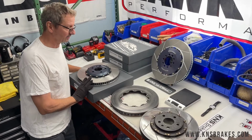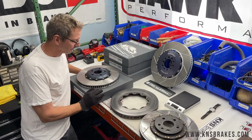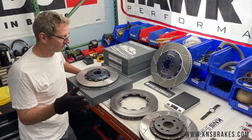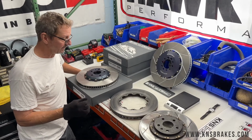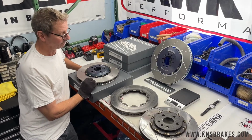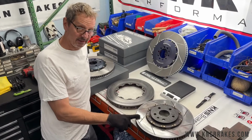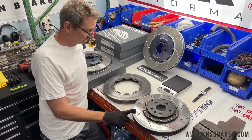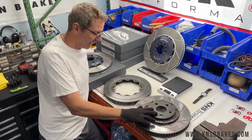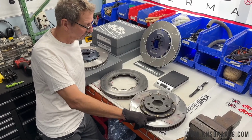And just as a comparison, we want to show you the other parts on the car and explain the differences real quick. Basically it's a 372 by 34 millimeter two-piece rotor assembly, both OEM and the Girodisc as well. The first differences are pretty obvious. You can see this is a Girodisc replacement rotor ring that we've had good experience with already, and that works with the OEM GM Brembo hat. And you see their hardware design. We've been selling these for quite a while.